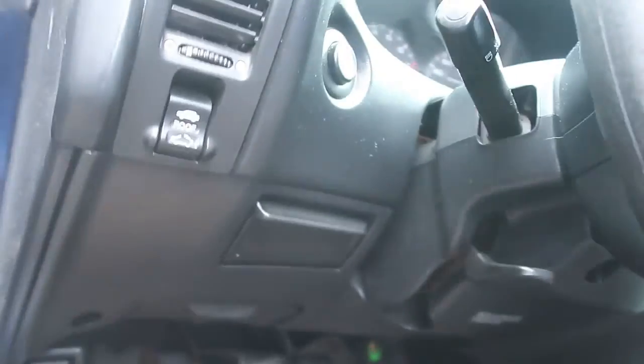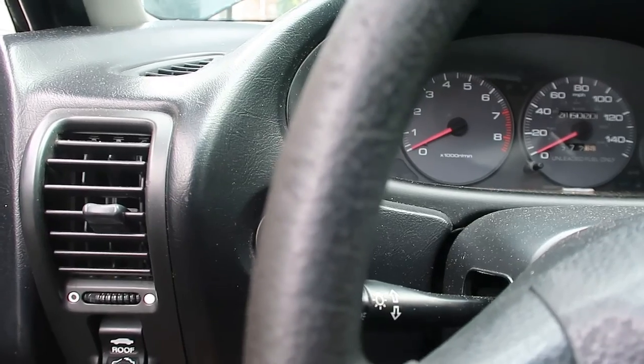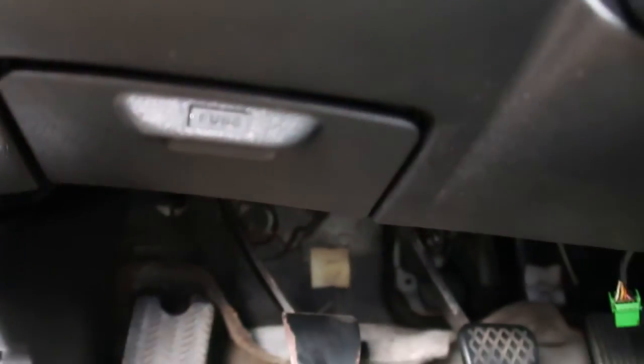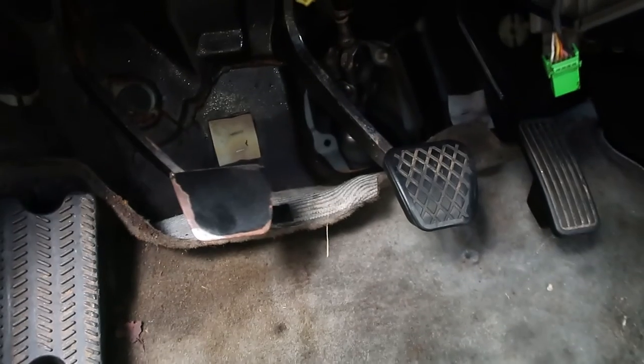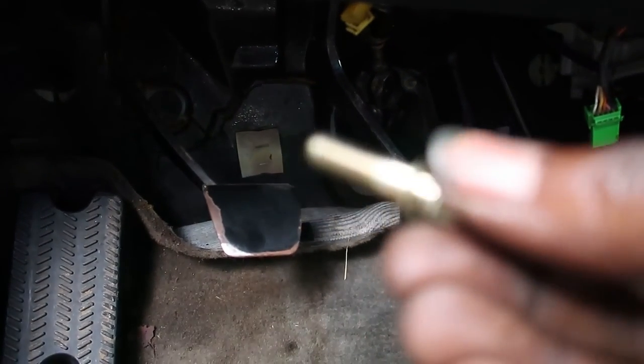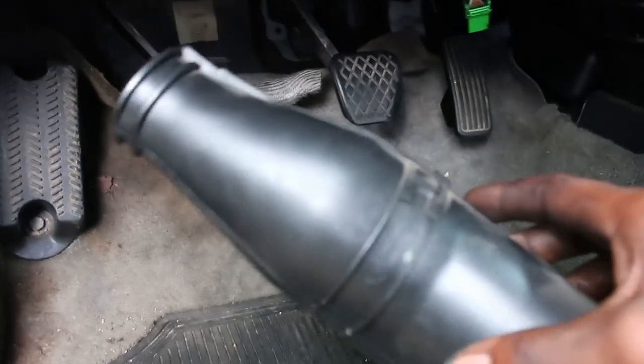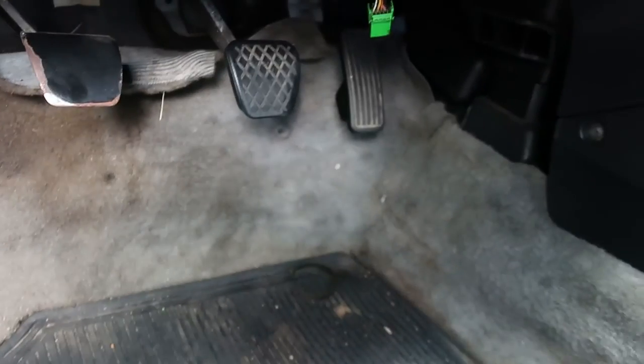Make sure the steering wheel still straight. All right, go ahead, tighten up the bolts. And you can move the steering rack now that it's connected. So you move the bolts, you move the rack around to get these bolts back in. Cover back on, clips back on.